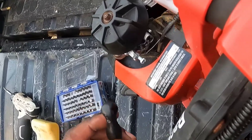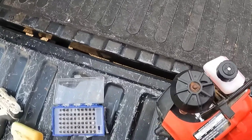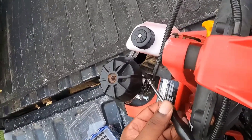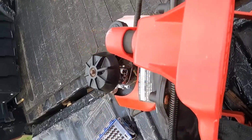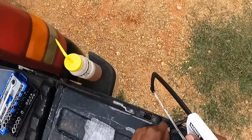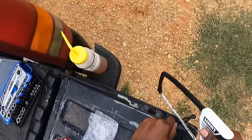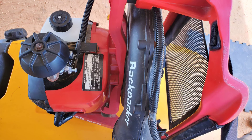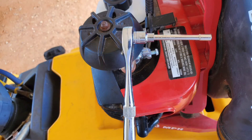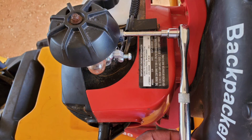There are carb adjustments — a high and a low. Can't really get to them — man, you really can't get to it. I didn't catch this part on video where I made a carburetor adjustment tool, because I couldn't fit the original tool in the space. What I did was cut it in half, attach it to a socket, then attach the socket to a three-eighths ratchet, and got it done.